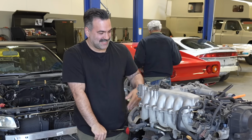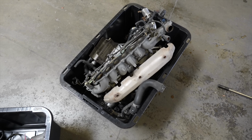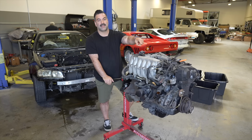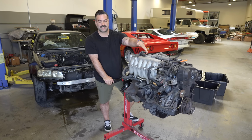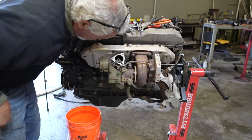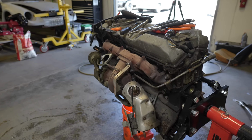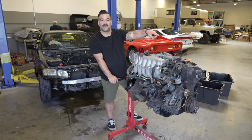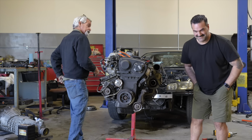All right, motor's out. Adrian's going to go ahead and take off the stock crossover intake manifold. We are going to save the stock oil cooler waterline system. We are not going to run the ones to the throttle body because we have a new bigger throttle body that doesn't have those provisions. Remove the complete hot side, so turbo manifold, stock turbo, all that stuff is going to come off. We have a complete new valve cover set that is going to get painted and a new front timing cover set that is billet from 5.0 Ignite, along with a new trigger sensor setup from NZ Wiring.